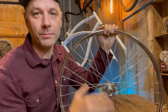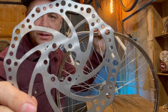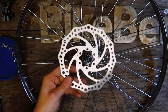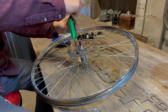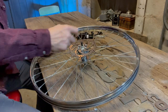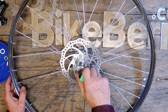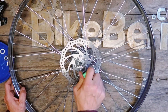Now we're going to focus on our front brake — a disc brake with a caliper bracket that we're going to mount to the front fork. If you noticed, it's got arrows right there that tell you which direction to put it on the rim and which way is forward facing. This has six mounting screws that go right into the hub — they're the Allen type, so you simply need your Allen key. Once they're all in, go around and snug them all up. You want to do a star pattern, like crisscross: this one first, then jump to the opposite, back to this one, then that one, going opposite each time, then your final one.